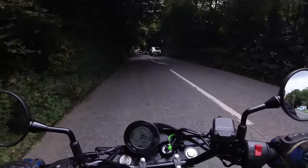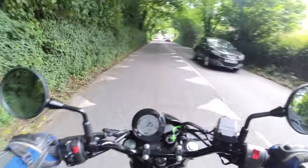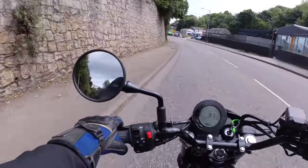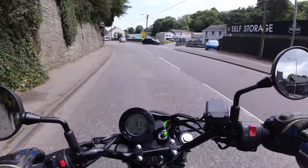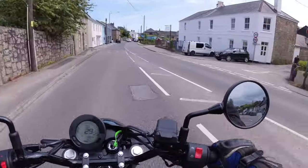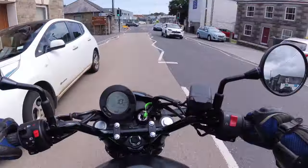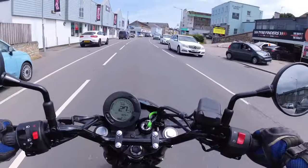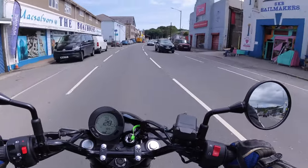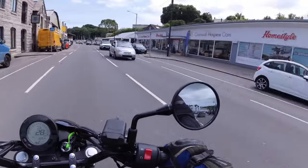For mixed urban, semi-urban, semi-rural riding it's a great bike. Probably not ideal for long-distance cruising, but at 67 miles per gallon you're good for at least 150 miles from a tank — even for long journeys you're probably only doing one fill-up. Gears are quite closely spaced. This version has gaiters at the front. Fourth at around 30 miles per hour is a reasonable compromise — about 3k revs — with enough pickup without screaming the engine.